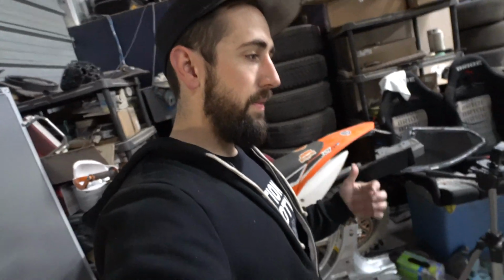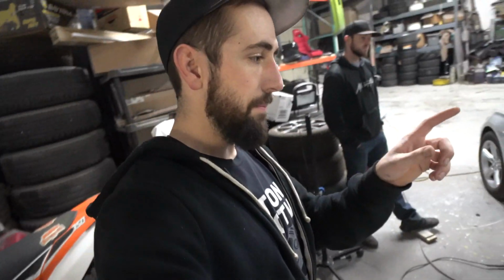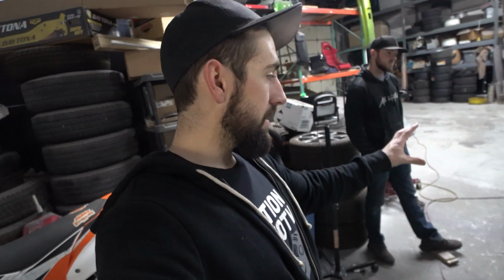Again, in the next video you guys are going to be seeing this thing getting welded up. Go ahead and get all the seam sealer and everything on there, do the bodywork on it, and then probably prime the doors, the back sides of the doors, and then the jambs. And I think going from there, what we're going to do is get the doors primed on the whole backside, get the jambs and everything done on it.